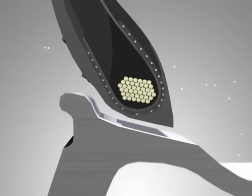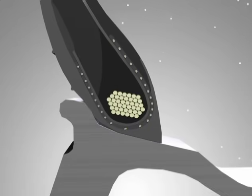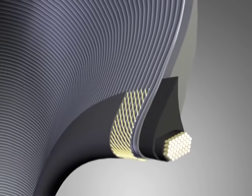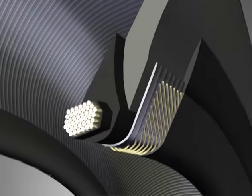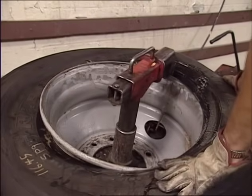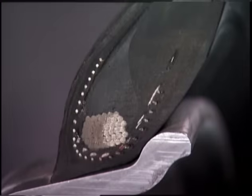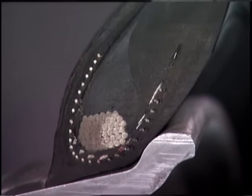Since the entire inside of a tire is open, it is the compressed air that forces the beads against the wheel flanges, sealing in the air. There is also a small additional component made of wire or wire and fabric called a chafer. It covers the bead bundle and ply turn-up, providing protection against damage that might occur when the bead is forced over the edge of the wheel and as the bead moves against the rim flange. A tough rubber compound also protects the bead area from abrasion and helps make beads more rigid for further damage protection.